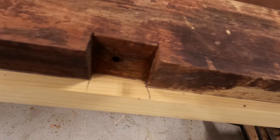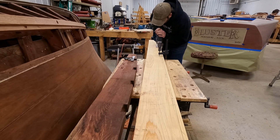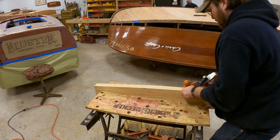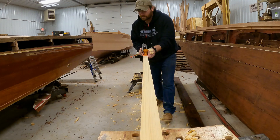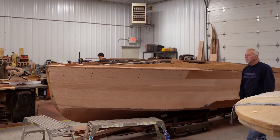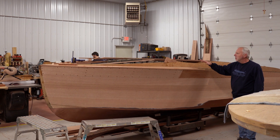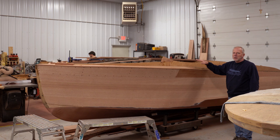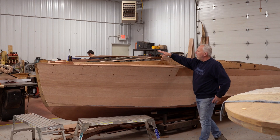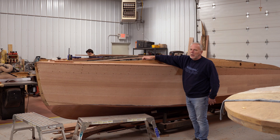I'm going to show you what I'm doing. 1930 20-foot triple Chris Craft. We are starting on the decks — we have all the decks removed. This boat was a little bit of a problem in the earlier videos. I may have mentioned that these had steel fasteners in it and they were really hard to get out. But we have got all the wood re-sawn for the decks. We've got the covering boards done, almost completed, and then we'll start on the decks and the deck seams.